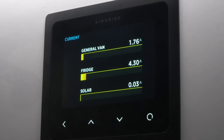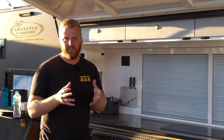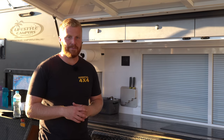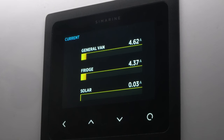We generally see about 5 amps while the compressor is on, but this will quickly increase in hot weather or when being opened frequently. Keep in mind that the fridge compressor will turn on and off to regulate temperature, so it's not going to be drawing 5 amps every hour all the time. But this 175-litre fridge does stay on a lot, so it is quite power-hungry. LED lights don't draw much, but if we turn on all of the interior and exterior lights and kitchen and storage LED strips, the total is around 4 to 5 amps — so it's noticeable, but you would never ordinarily have this much running together.